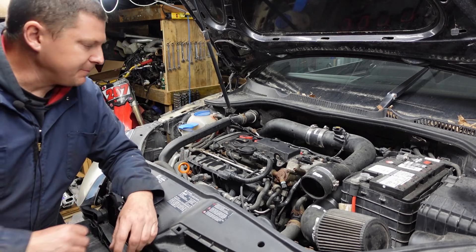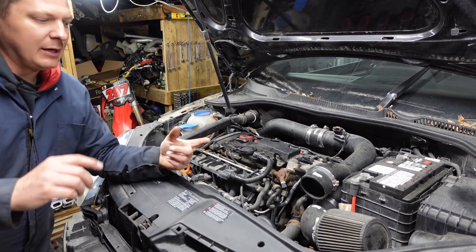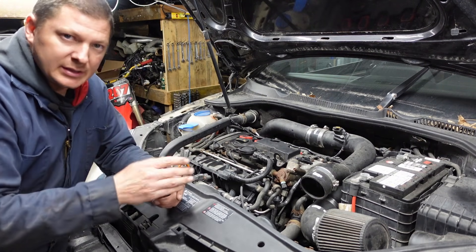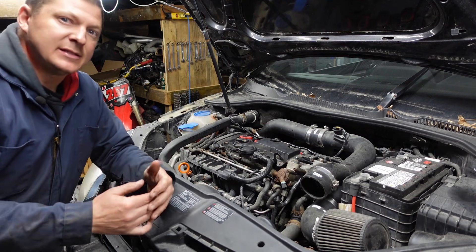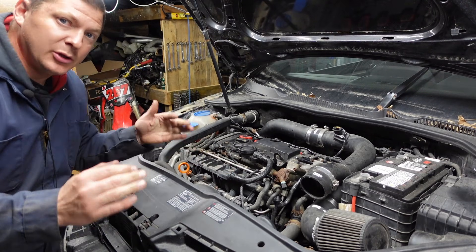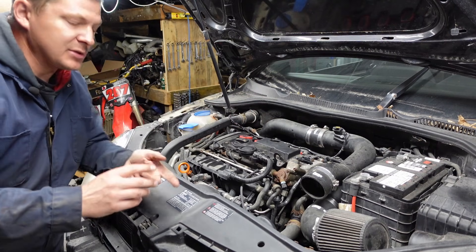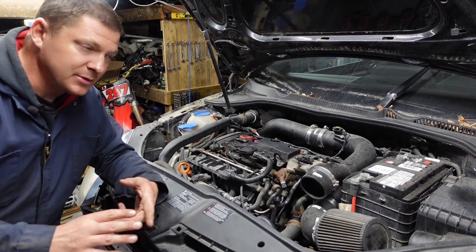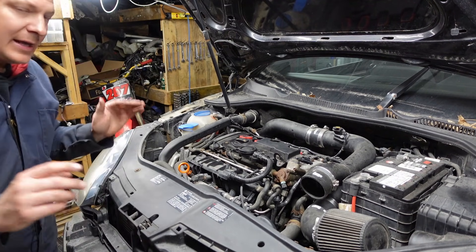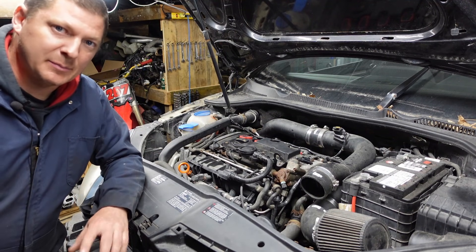However, it's still not quite right. One major thing that lets me know the PCV is an issue: codes keep coming up in the ECU for excessive lean condition. Basically it's trimming the fuel maps trying to get closer to a perfect air-fuel ratio using the oxygen sensor. A lot of times you'll get codes like excessive lean condition or running too lean. I'll start the car up and then we're going to have a look at another big way to tell that this is a PCV issue.